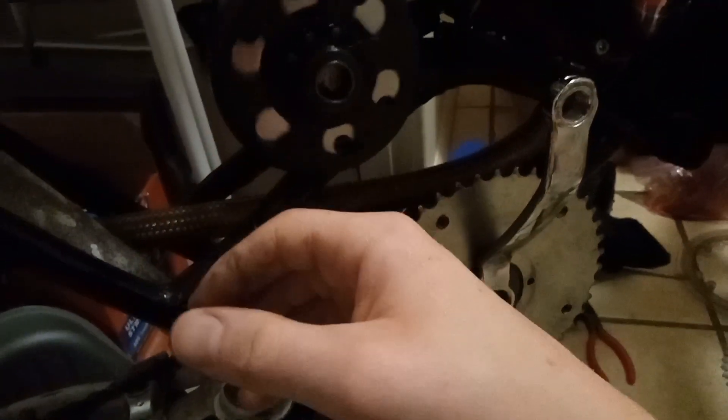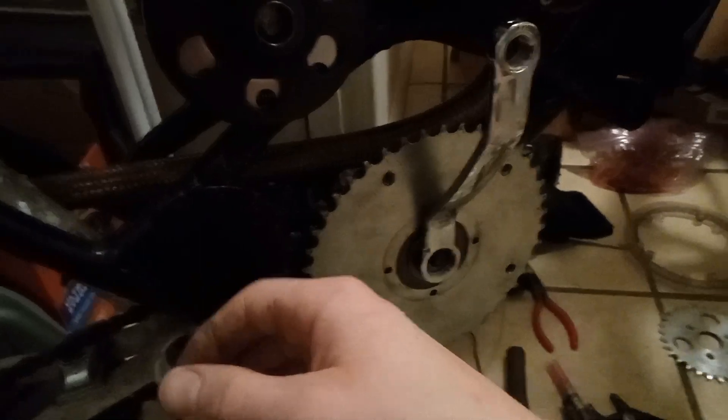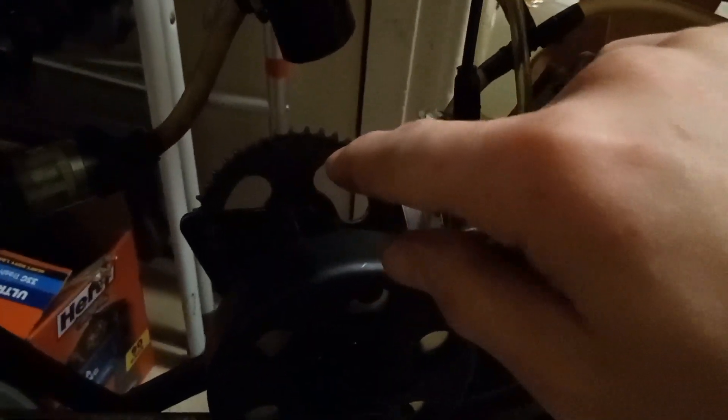This one has around a 420 though, because of this sprocket size. Essentially it's going to be a one-to-one ratio from here to here, so I bypass this clutch and I can use a higher torque, higher power output clutch to drive this whole system.